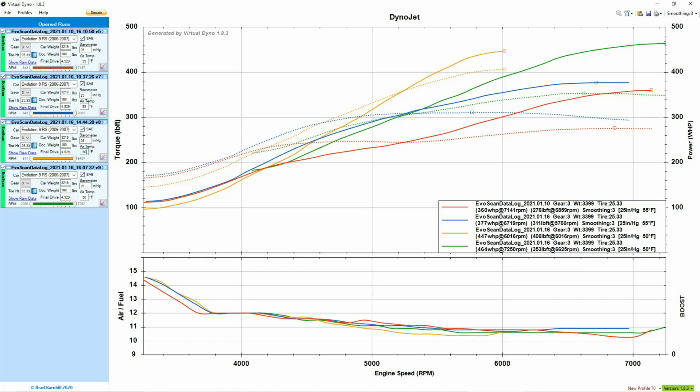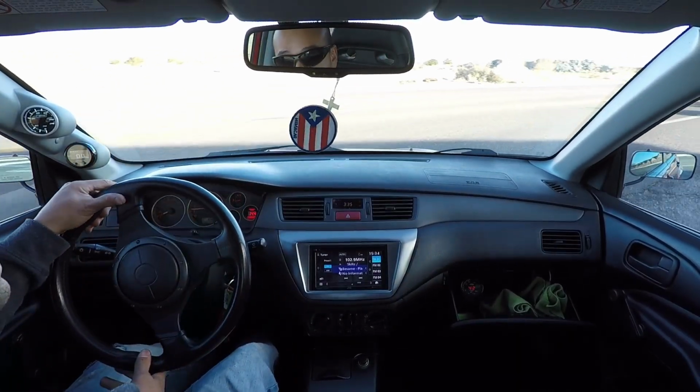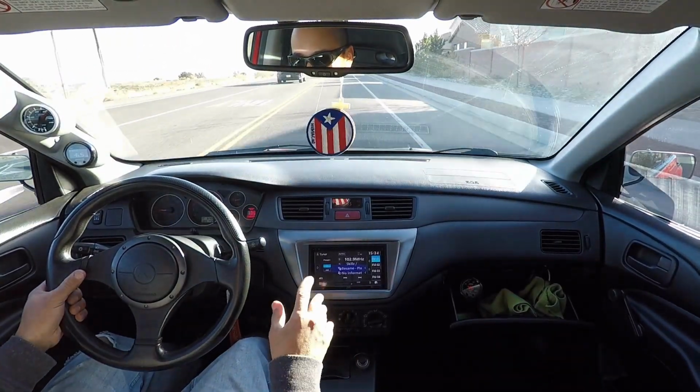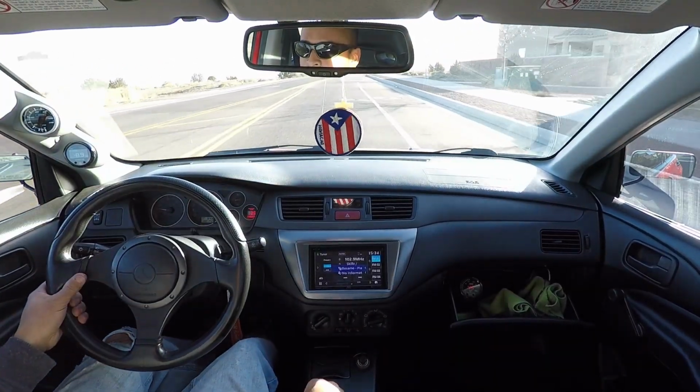Now, Vic's car, as I mentioned earlier, is a stock bottom. We are going to put it in a Dynojet, I think he's using, to make sure that he's not crossing the limits of his stock bottom. But yeah, this is basically to show you guys what the process is for e-tuning. Went back and readjusted wastegates and did his magic there on the ROM, and boost on version 9 was about 25, 26, mostly 26, so pretty much what we were targeting.